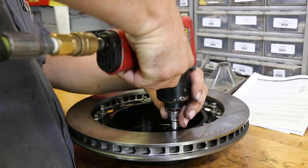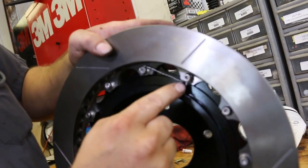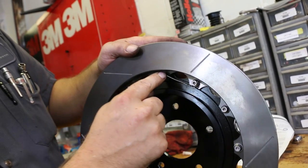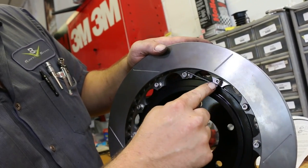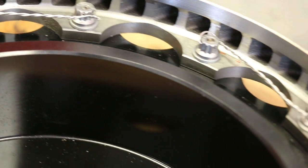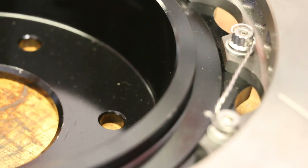The point of safety wire is to prevent bolts from backing out. If you look at the path of the bolt and the wire — if this bolt tries to back out, it's going to turn counterclockwise. That's going to pull on the safety wire, which is on the bottom side of this bolt, which is going to try and turn clockwise to tighten it up. This bolt backing out isn't going to be able to tighten this bolt up, and vice versa. That's basically how this process works.